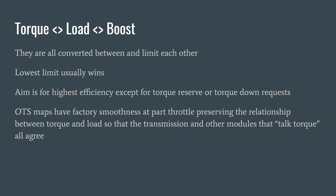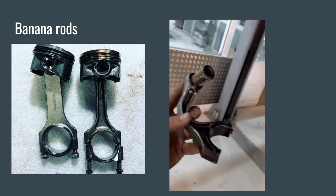On DAZA, a particularly important feature that everybody's concerned with on the stock engine are the rods. A lot of people on this platform are talking of 100 to 110 pound-foot per cylinder, and you could multiply that by 1.36 to get newton metres and stick that in as a torque target or limit — and that can work for a stage 1 tune. We don't do it that way because it isn't really very extensive, and once you start modifying the engine beyond stage 1 the torque values are no longer accurate. Dynos can easily vary 20% between each other and day to day.